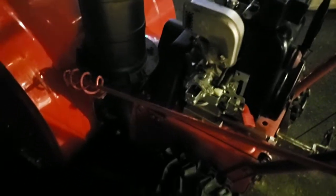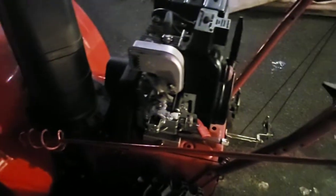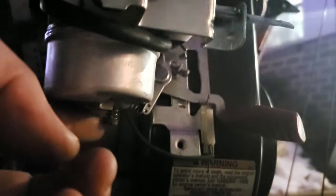the panel cover over the carburetor here, and this should treat him pretty well as long as it keeps the gas out of it. A lot of people don't realize this, even if you run it dry, you need to push the float drain there.